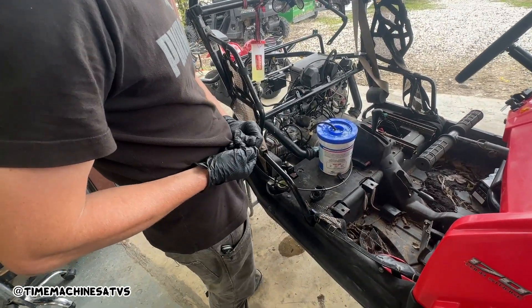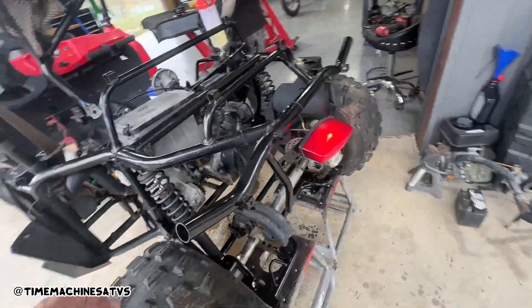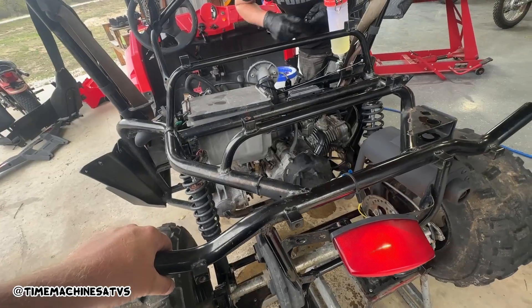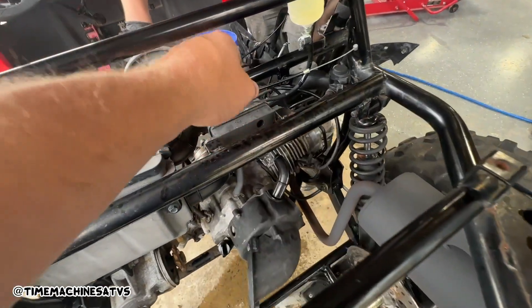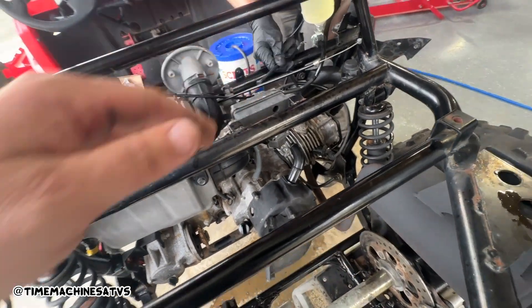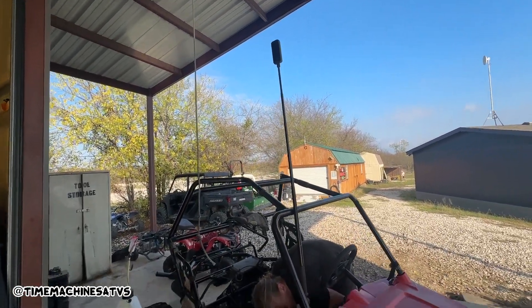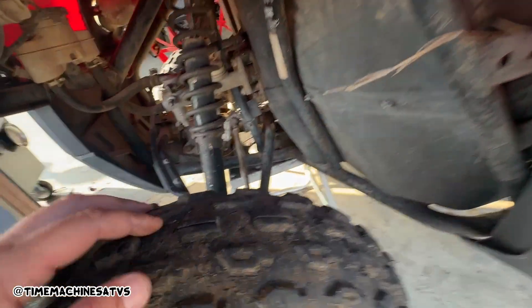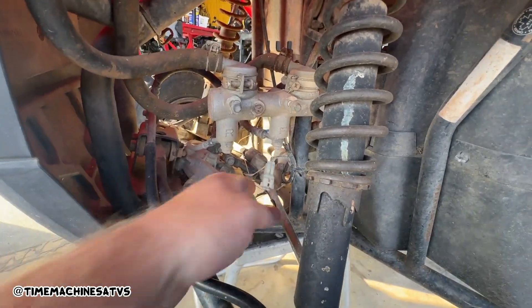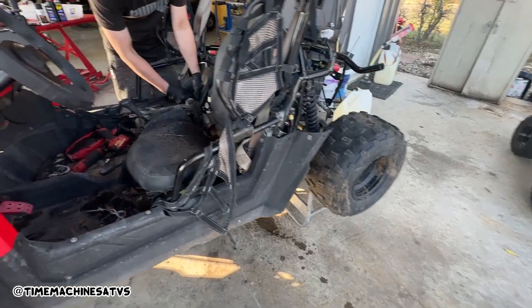I wonder if it has a neutral sensor. Right here — yeah, it's in gear, the chain's off. Sprocket's moving now, moving a little. That's got to be one of these things going on. I won't even run with that off — try a little throttle. That's our whip for the dunes! She's still pretty perky so I need to milk her. Had to do with this throttle cable sensor — we took it off, that didn't work, so we spliced them together. No more papa-papa sound.